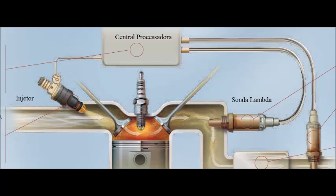Both sides have electrodes which collect the voltage that builds when oxygen ions move from where concentration is higher to where it is lower. This voltage, generated by the electrochemical process, varies under normal operation from 100 millivolts to 900 millivolts, though it can vary depending on the manufacturer.